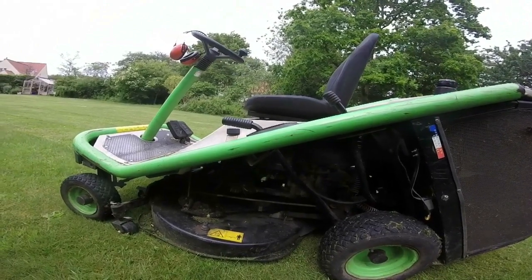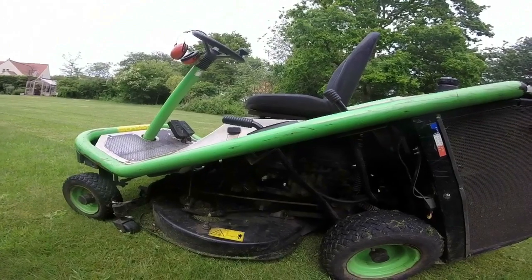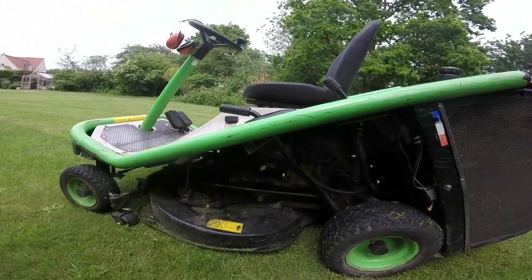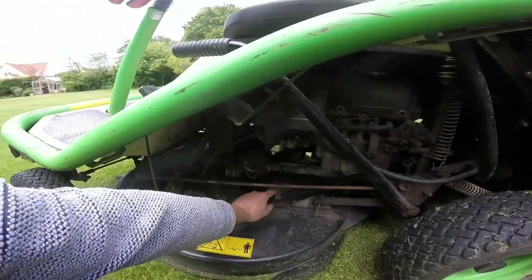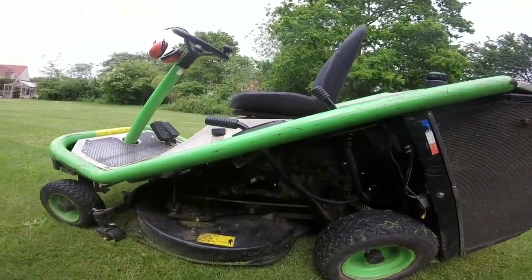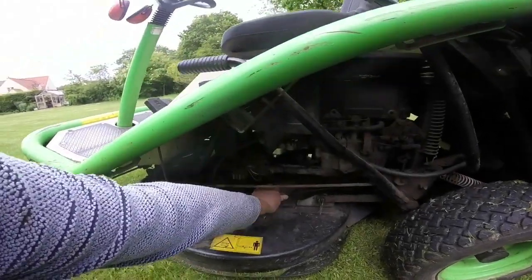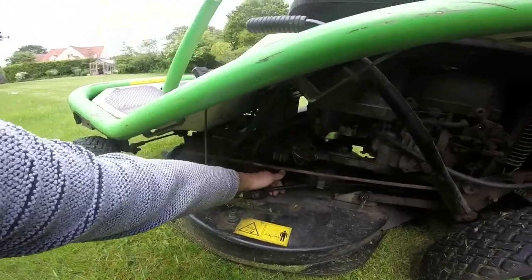So if it wears out, once it starts squeaking, they're wearing out. That's what happened to the last one. So yeah, I can just replace it quick. Only minutes to replace. Just loosen up the 10mm bolt, and then it just goes on, because it's an electric clutch, so it's just a switch, so the tension is on it all the time. There's just that sort of system there that moves up as you put the deck up and down.